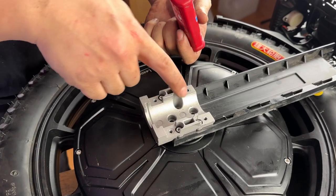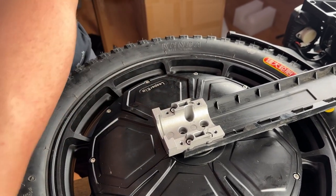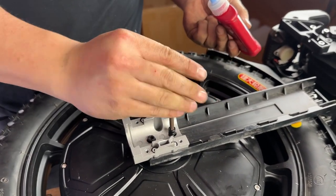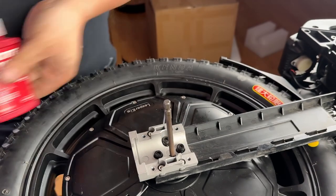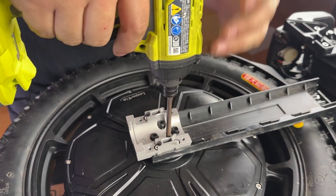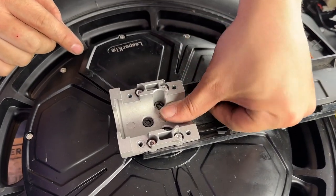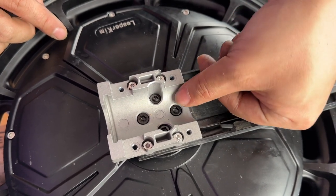Next, locate your motor bolts — these are five millimeter black hex bolts. Apply some blue Loctite and make sure you hand-thread these in to prevent cross-threading. Once you have hand-threaded all four bolts with blue Loctite, use your driver to tighten them down. After tightening, do a last check with your finger to make sure the semicircle is smooth and that your finger is not getting caught on the edge of the screw, as this may damage your suspension.